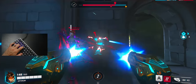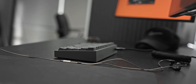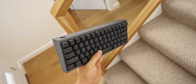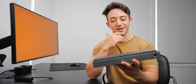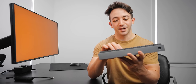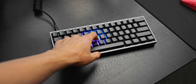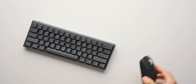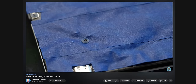Of course, if you're running the default or a straight cable, there's no reason not to use Tachyon mode for the full 1000 Hz polling rate. For physical customizations, I've taken the Wooting PCB and put it in a 60% Tofu aluminum case from KBD Fans — this one in dark grey looks pretty clean. I also went with a blank black keycap set from Enjoy PBT, and I spent an entire afternoon lubing all the analog switches. It does make a more premium sound, especially combined with the metal case. Massive shout-out to Bad Seed Tech whose idea I basically borrowed — he has a great video on modding the Wooting if you want to go further.